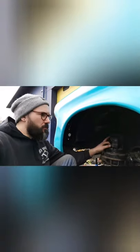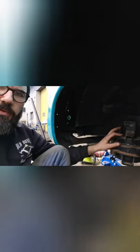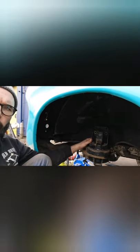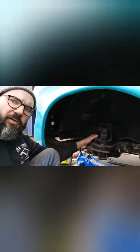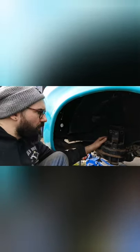Me and Nathan have spent the morning stripping the front suspension out of the Husky, and this is what we're left with. You see these turrets here, we're gonna cut those clean off, lose those altogether, and then through the subframe here, we'll have enough room for bag expansion, so that's not gonna be an issue. But we will have to fabricate complete new top mounts for our air shocks, and then incorporate that in with a brand new top A-arm design. So yeah, give us a few more hours and we'll have a bit more of an idea of where we're going with that.